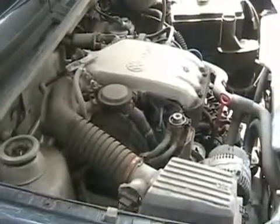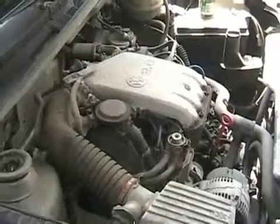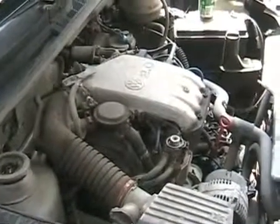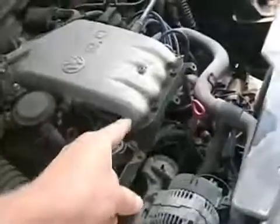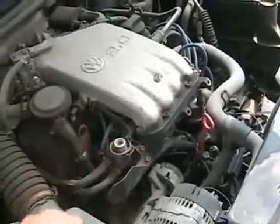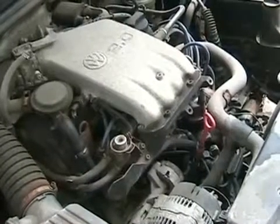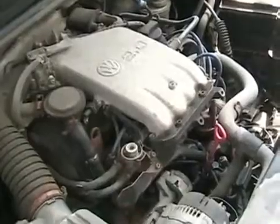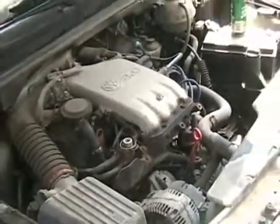The idea being, in between every stroke of the piston when it's waiting for its new charge before the valve opens, already a pocket of air has collected in that tube, and it's there waiting undisturbed, ready for the next charge just to get sucked in. So that makes the engine torquier at low RPMs, and at high RPMs it has another advantage too.